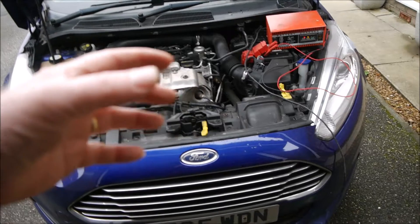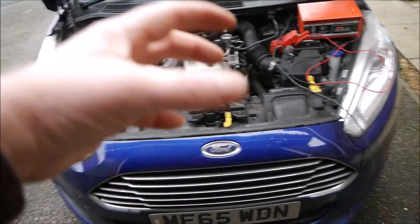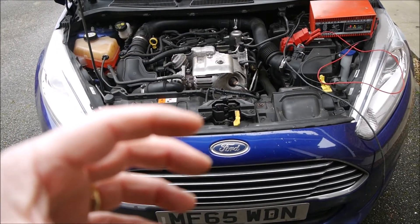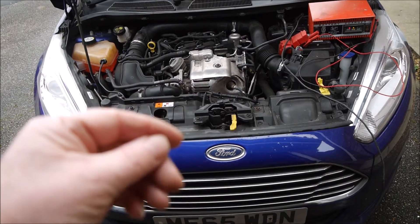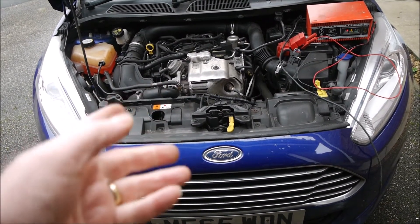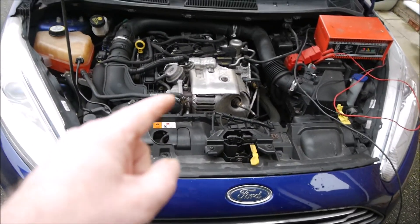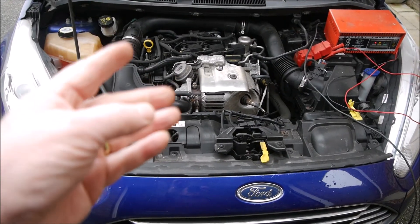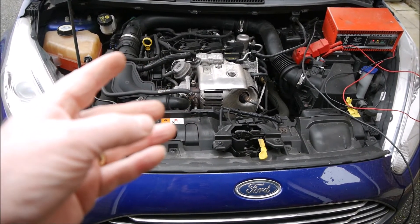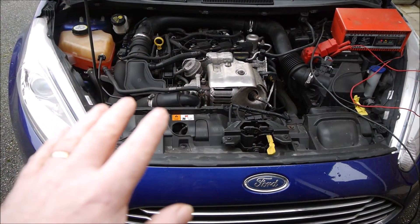The easiest way to fit a new engine is to take all the front end off the car and rather than lift the engine out, you pull the engine forwards - you take it off the gearbox and pull it forwards. However, I would just like to get this engine running again, but it depends on cost - if we're into re-grinding the crank and doing the top end. The cam belt hasn't snapped because it rattled before, so we haven't got any bent valves. Let's just see if it's recoverable. Worst case, new engine.